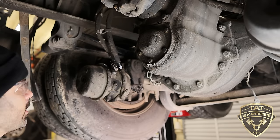So we got the brake chamber off. As you can see, it's got a bracket here for the ABS. You want to keep all this in place. You can see how this bracket goes on here. The slack adjuster is spring loaded. That's why it's come back so far up against here, but you can adjust it back some more. You can see this chain here. This chain is actually more of the tension on this side, but this is just chained up for the free hanging axle since we have it in the air. So let's move over to the table and get the new brake chamber sized up so we can get this installed and get this repaired, wrapped up.